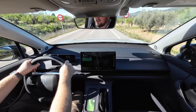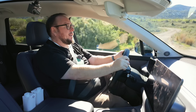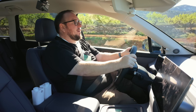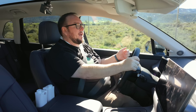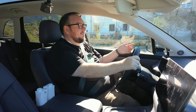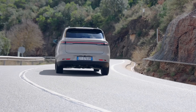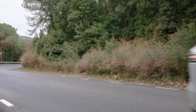Does having that engine up there make a difference to the way the car drives? Really not much. The car performs pretty much the same way with the same power output - 158 kilowatts and 320 newton metres, 0 to 100 about 7 seconds. It's fine; it's not the fastest EV/hybrid out there but performance is adequate. The ride is quite comfortable and usable, not overly firm, nor is it a sporty exciting car. The steering is a bit numb but works fine. One interesting thing with the range extender system, where it feeds into the battery and then into the motor, is that it comes with some benefits and some negatives.